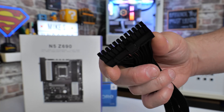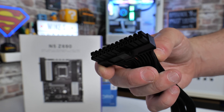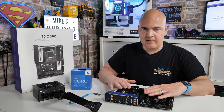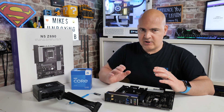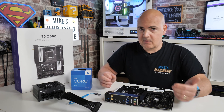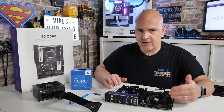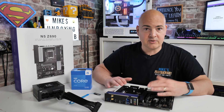Something else you're going to need is a power supply. You only need to connect the 24-pin main power connector, so you don't have to worry about connecting too many wires on your modular power supply. I would also say get something to put the motherboard on whilst you're flashing. Some of you may have this already installed in your case, but in my personal opinion and experience, it's generally better to do the motherboard first before you do your build. That way, if the BIOS flash doesn't take or something goes wrong, you've limited the variables. If it's installed in the case you could potentially have a motherboard pillar in the wrong position — those kind of fault-finding issues which you don't have to deal with if it's just on a motherboard box or an anti-static surface.